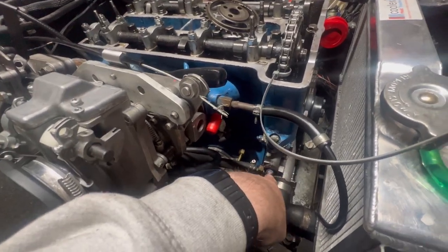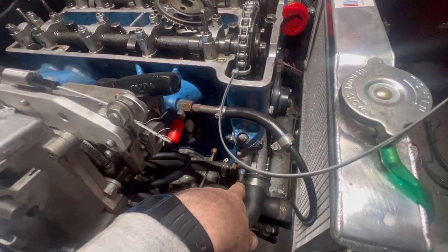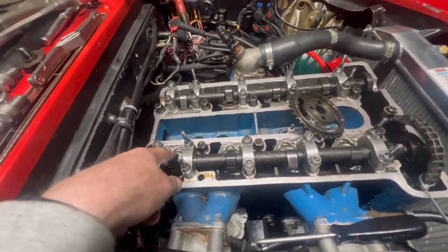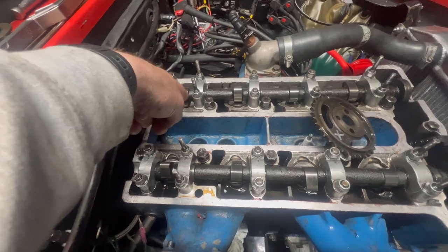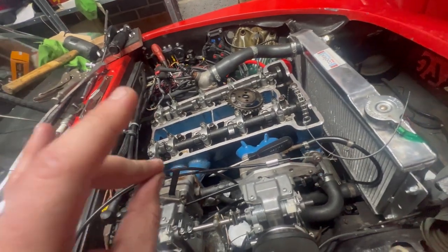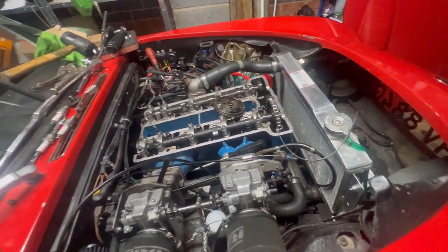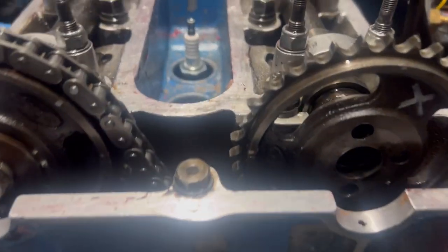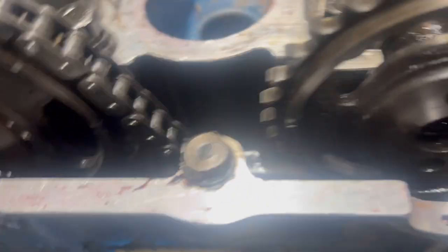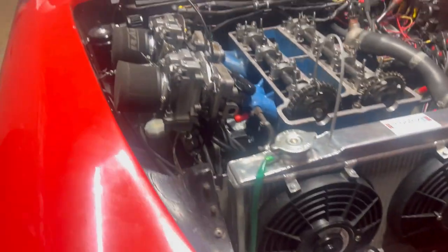Miles says, bloody hell, undo that 5/16, wind this out, and then I will get the cams so that on 4 they're just starting to touch. Wind it to top dead centre, hopefully nothing touches. Slap the chain on. Right, both camshafts around, so now I'm hoping I can turn that bad boy down there around to top dead centre without anything getting all rucked up.